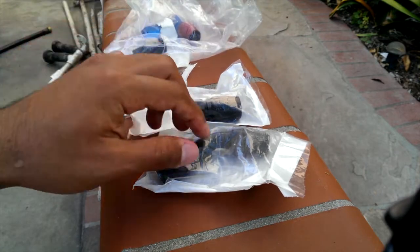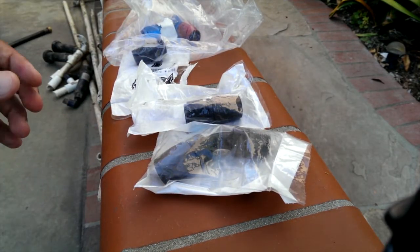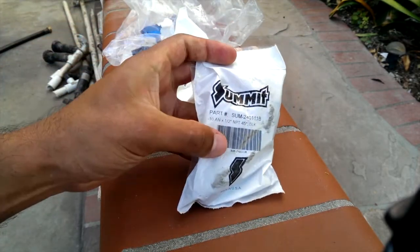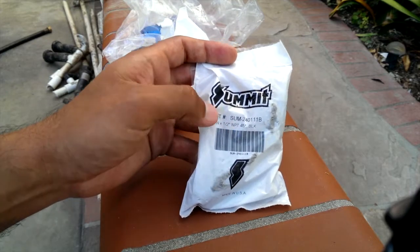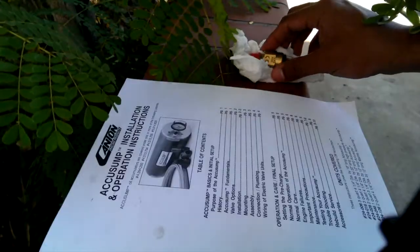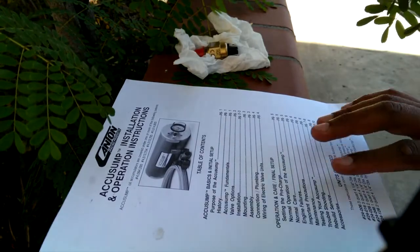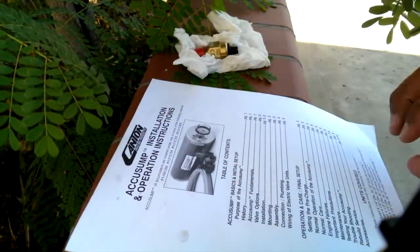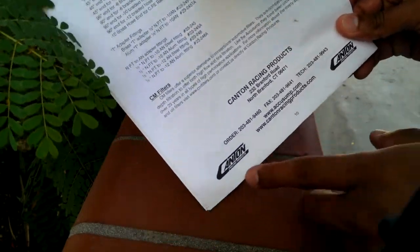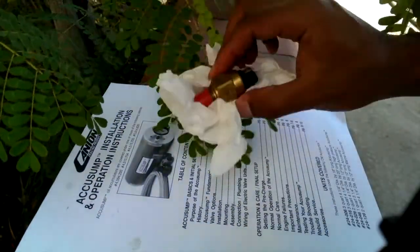To build the AN hoses you're going to need some big wrenches. Most of my tools are metric, so I went with a 21, 22, 24, 25, and 26. If you have American tools that match perfectly, even better, but definitely recommend having some spares — if you mess up the fitting it's trash. These are what's included with the kit. I have those as spares: a spare coupler, a 45, and the straight fitting. The hose I used is 10 AN, half inch NPT. I got these from Summit Racing.